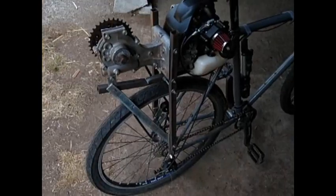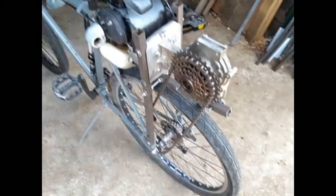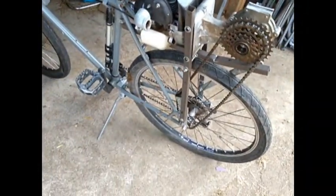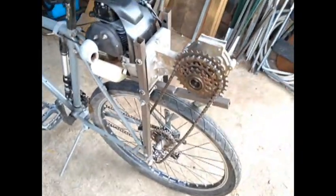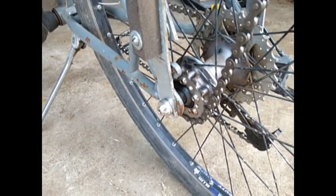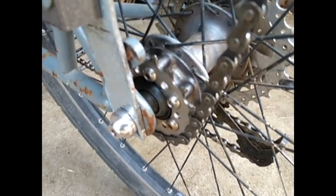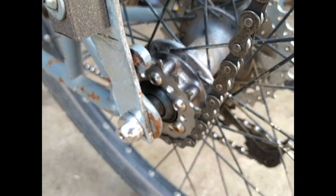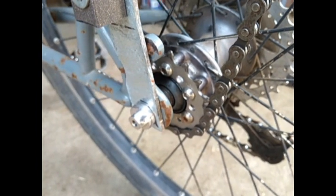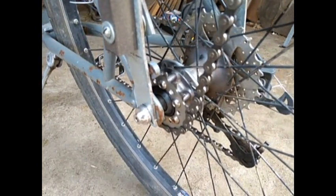The idea with this project and the way I was using this motor was to mount it directly above the rear wheel. Only this time instead of driving the right side, it's driving the left side. The way I did that was on this wheel — it's got a disc brake mount. With the disc brake mount, I picked up this sprocket that mounts directly to the disc brake bolts. It's a really hard mounting point — no slop, perfectly aligned.